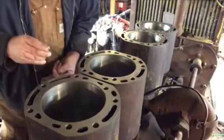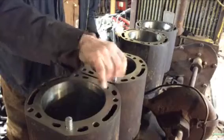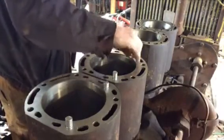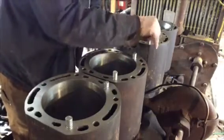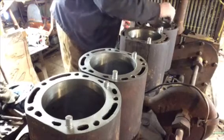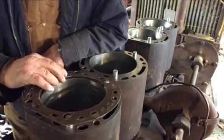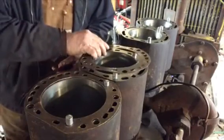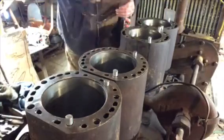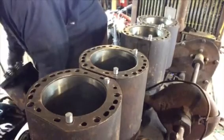I'm back up by the tractor. First thing I do is put 2 of my pilots in each cylinder. Then set the head gaskets on. Now I'll go get cylinder head number 4. Here we go. I'll tell you, these cylinder heads aren't getting any lighter.